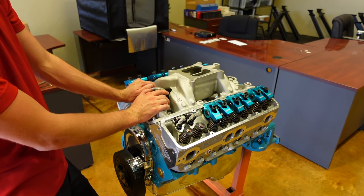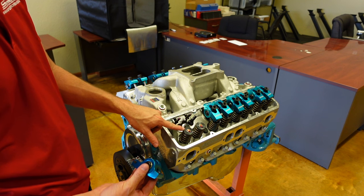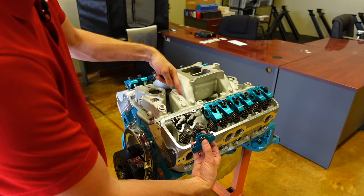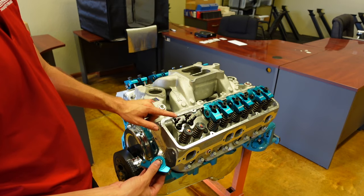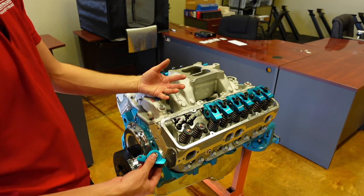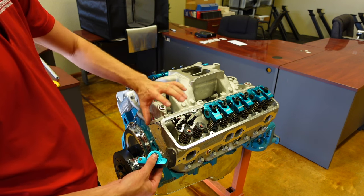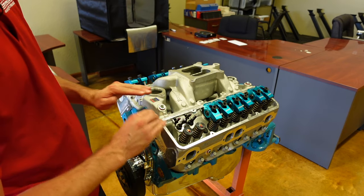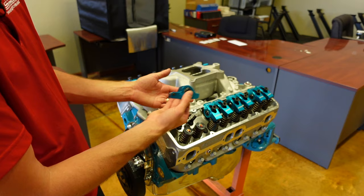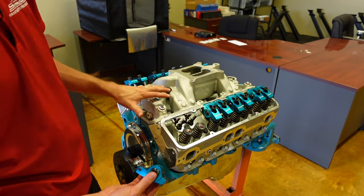We're working on a small block Chevy hydraulic roller combination. We have our rocker arms here, and let's say we're going to start by setting the exhaust valve here in the front of the engine — you can tell it's the exhaust valve because it lines up with the exhaust port. This one's obviously the intake valve because it lines up with the intake runner. To set the exhaust valve, we need to first position the exhaust lifter and pushrod in the right orientation. The lifter, camshaft, and pushrod need to be on the base circle of the camshaft — meaning zero lift, zero duration, the valve is completely closed. If you set your rocker arm up while the camshaft is trying to open the valve, your adjustment is going to be thrown off completely. So how do we find out if the camshaft is on zero lift when the intake is already installed on the engine?